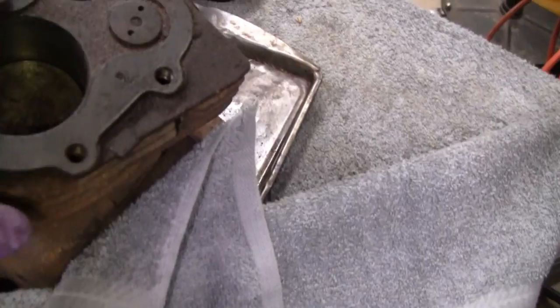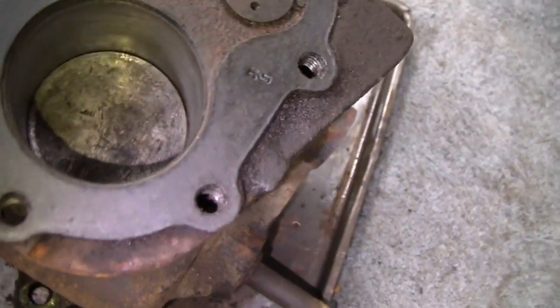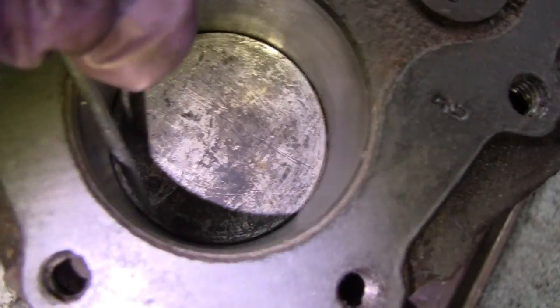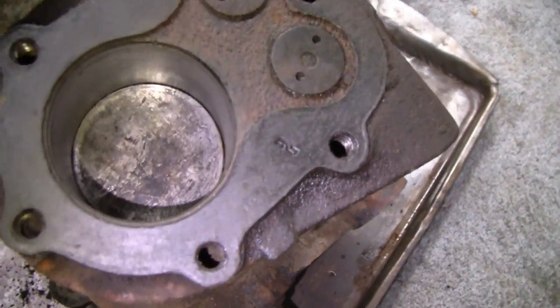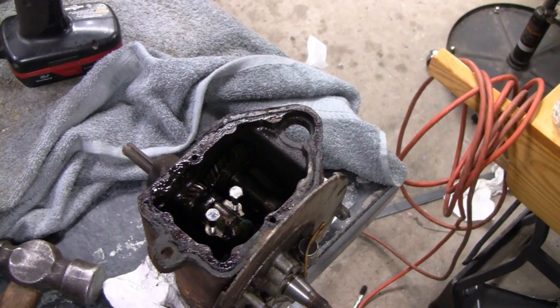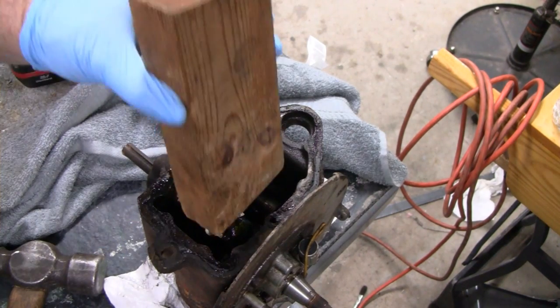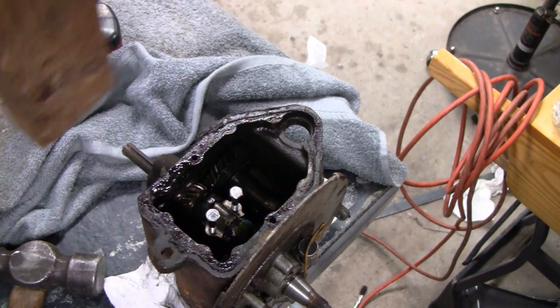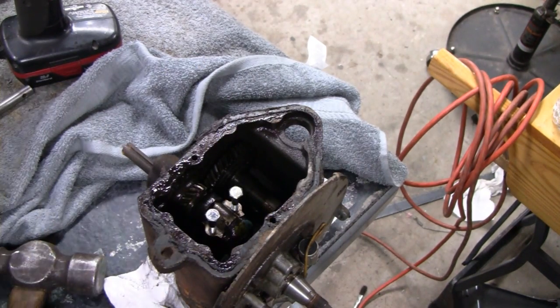I'll turn it over and work on this rubber here underneath so it won't damage the head or the surface here. I'm going to mark this too — this is the front of the piston pointing towards the front of the engine. The exhaust and the carburetor are the back. We'll put that piston back in the same way it came out. What I did was I put two bolts in the connecting rod there and I'm gonna hit them both with a piece of wood. Once I get it down a little further then I might have to hit the skirt — we'll see what happens.